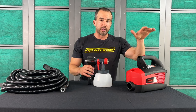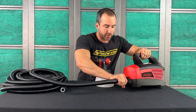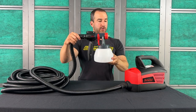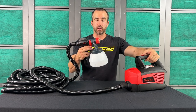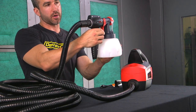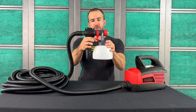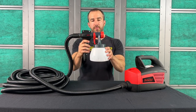When you're ready to spray, you've got your DYC G4 turbine and your hose. The smooth portion of the hose pushes right into the front of the turbine — make sure it's nice and snug. You've got the quick connect at the end of the hose; make sure that's tight, then snap it right into the back of the gun. As soon as you turn your turbine on, push it all the way forward for the high setting when spraying a full car, or one click forward for the low setting. The product dial controls flow: screw it away from the trigger for a smaller spray fan, and closer to the trigger for a larger, more open spray fan. I like to put it a couple of turns away to get about a six- to seven-inch spray fan.